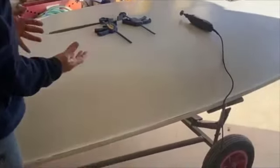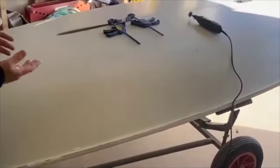You don't go cheap on a launch trolley. Make sure that the gunnel supports on your launch trolley actually fit in this channel properly. When you get out of the water, when you cover the boat, please make sure you lift it into place properly. Avoid sitting on the boat over the gunnel supports, and don't over ratchet the boat when you're towing it. Those are the common causes.